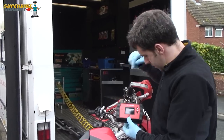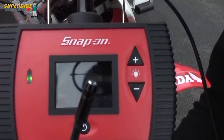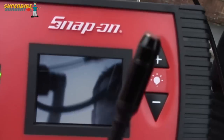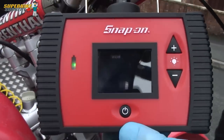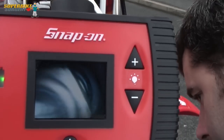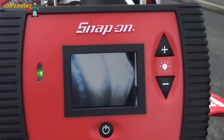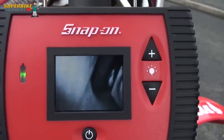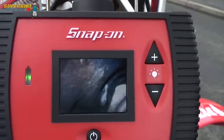So I've got a little camera here, which is a little bullet camera, and on the end it's got a little camera with an LED. Can you see the end of that, Benji? I can. So what we do is I'll poke this down around the spark plug and we can have a look and see whether there's any dirt in there or not. There's a bit of something there, but I think that's good to go.